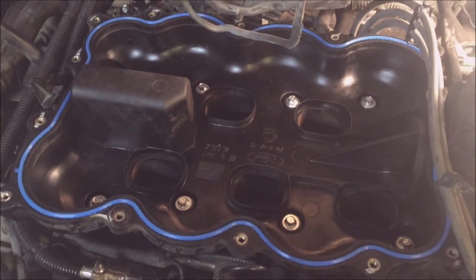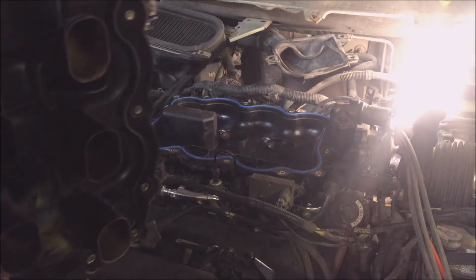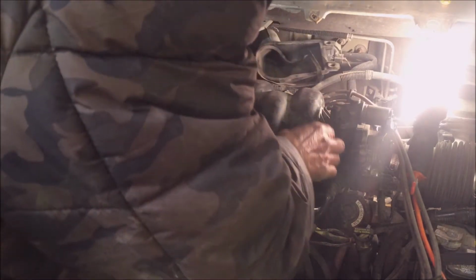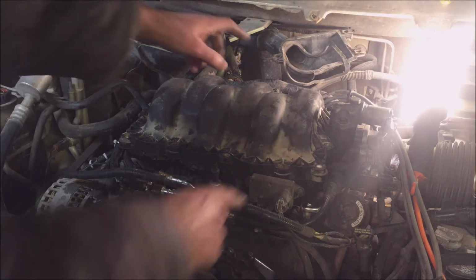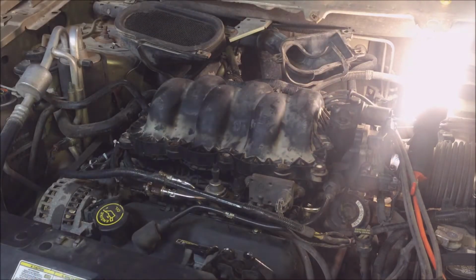That's the torque. I'm putting the top plenum on. The hump side goes towards the throttle body and the flat side at the back. Just straight on it goes. And torquing again. So I got a whole pile of bolts to put in. And these two over here is where you put your spark plug wires. The two long ones.